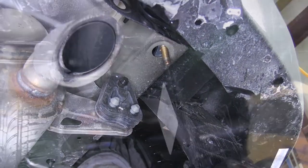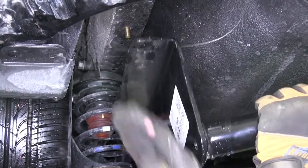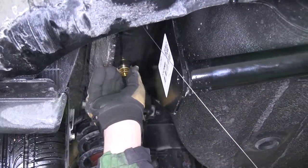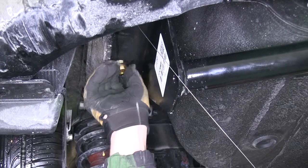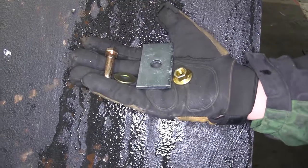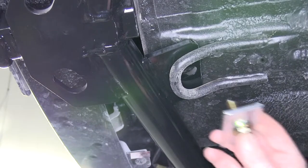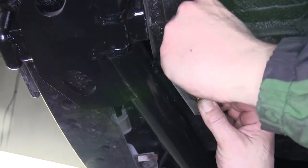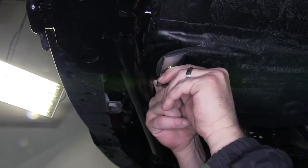Now with all the frame hardware in place, we're ready to put our hitch in position. Take the bolt leader and feed it through the attachment point for each side. We'll go ahead and install the flange nut on the forward attachment point. Now we're ready to install the hardware for our tow hook. We'll use the 3-8ths bolt, flat washer, block, and flange nut. We'll take the flat washer and put it onto the bolt, followed by the block. We'll feed the bolt through the tow hook and through the attachment point of the hitch and screw the bolt into the flange nut to secure it.